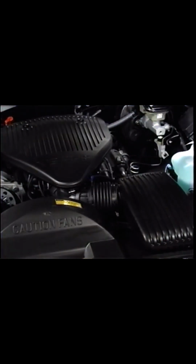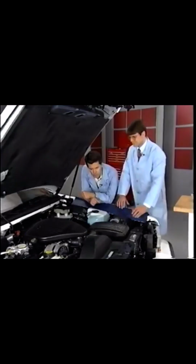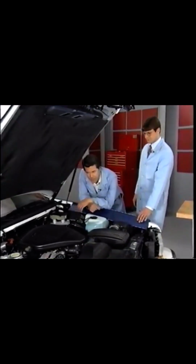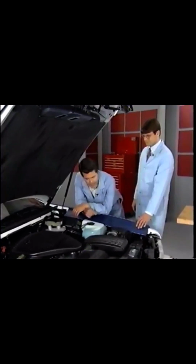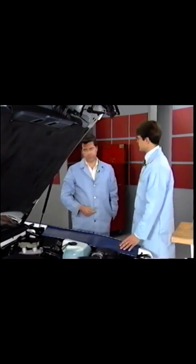Other problems may result if the air inlet line is plugged. In some cases, engine vacuum is strong enough that it draws the distributor cap down until it contacts the rotor. There's enough vacuum to actually bend the distributor cap. Amazing. Any tips on checking the ventilation system? Yes, but first let's start the car.